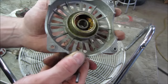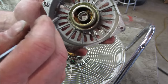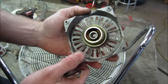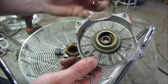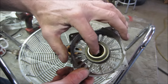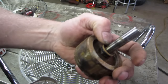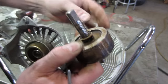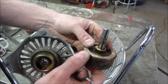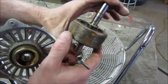Some bearings are impregnated with lube — they'll be like a bronze bushing, and if you look at them in a microscope they have little pinholes all throughout. There's an oil soaked into the bearing, and as temperature rises that thins out and runs to the outer surface. I wonder if this thrust surface here too — look at that crap on it. I wonder if this stuff I just broke off was maybe preloading it so there was no play. We're gonna go find out.